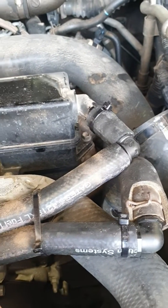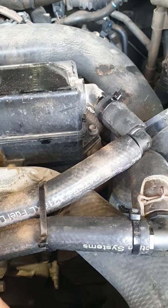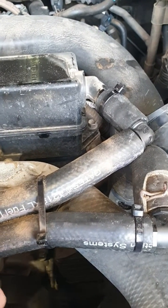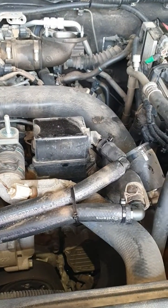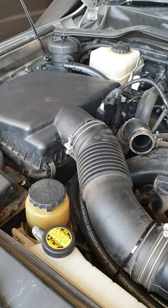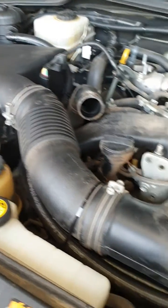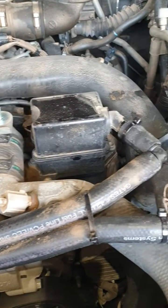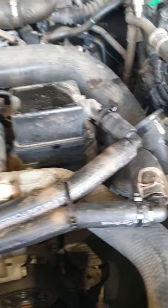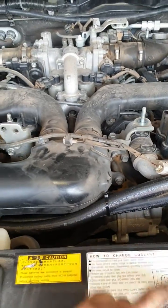Long term, of course, have a look at it online — you can sort of see when you look up turbo problems, passenger turbos play up very often on these LC200s when they get choked up. So get a catch can on, overcome that design problem. You can see more of these videos — look us up at YouTube, Instagram, or berrimadiesel.com.